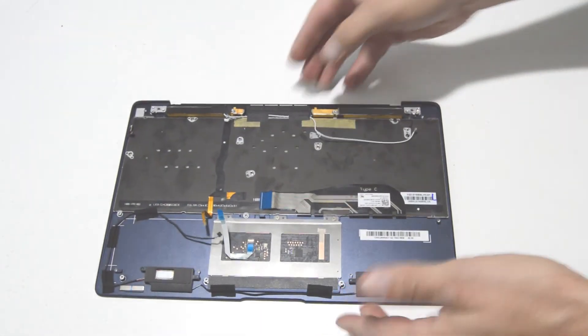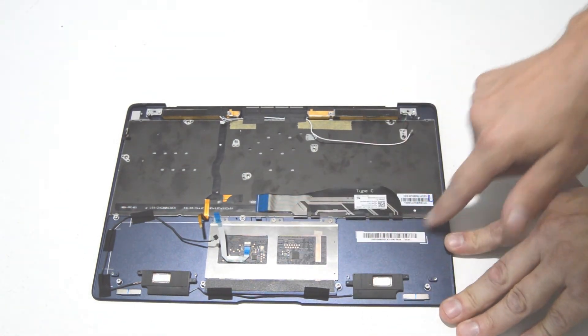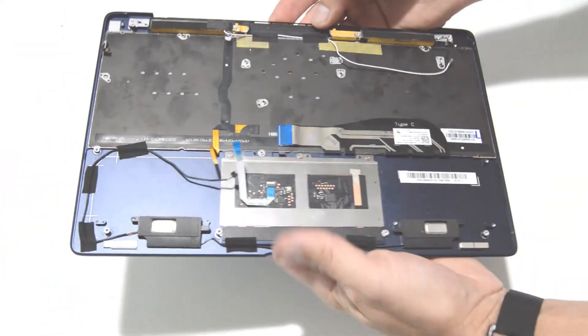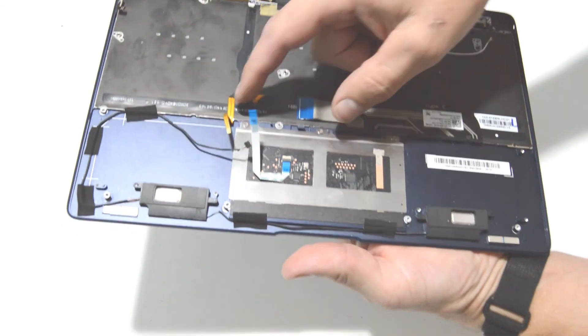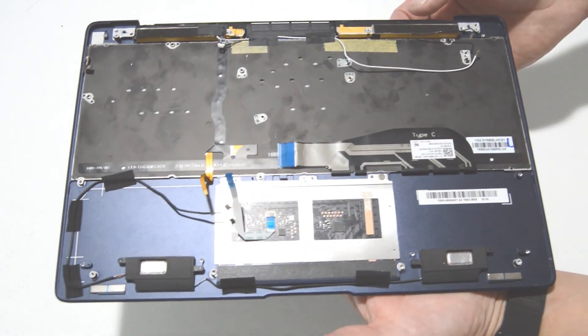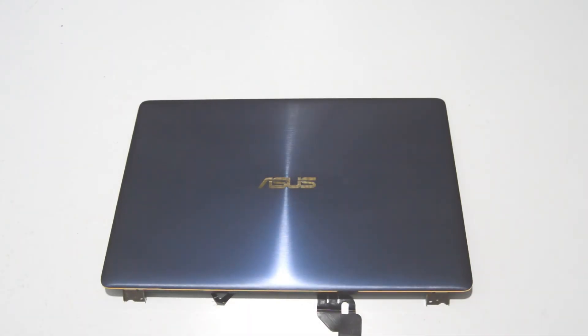For this one, we're going to leave the touchpad and keyboard as one unit — so there's your palm rest. If you need to remove any of the accessories or the speakers, just pop them off, and there are just a few screws for the touchpad assembly. That is how you disassemble an Asus UX390U, also called the ZenBook. If you liked the video or it helped you out, please give us a thumbs up and subscribe. Thank you.